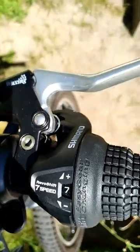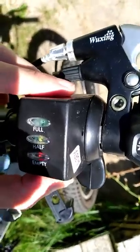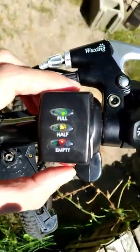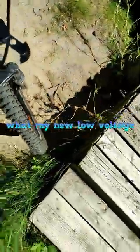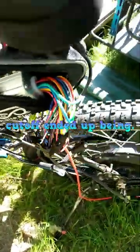I got the controller put back together — did the bare minimum to hook it up. I'm pretty sure I am totally successful without even going for a test ride, because my green light never lit up before since it thought I was at 48 volt. Oddly it says lithium 36 volt. Everything I ordered seemed to be wrong, but it actually moves — it works. So the only thing I can do now is test to see what voltage it cuts off at. It should be lower now.